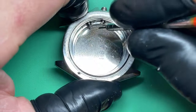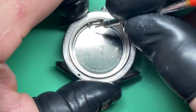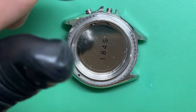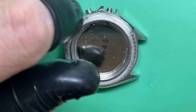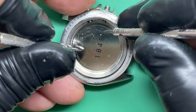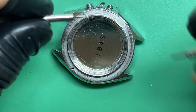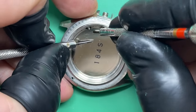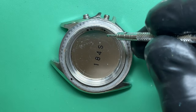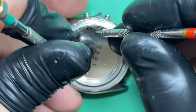So the way these are, the number one, these tiny circlips, people are justifiably scared of losing them. They do go kapoink because they're tiny, but you can still find them. Seiko used them in a million, billion things. In fact, I think they're even still available. But any of the smaller quartz watches, especially the LCDs, will have this.